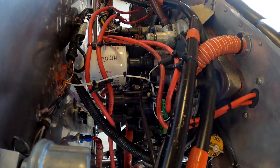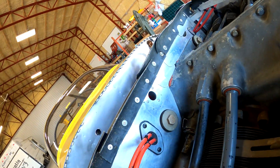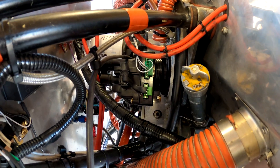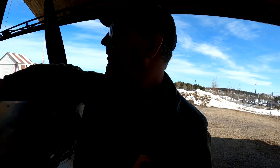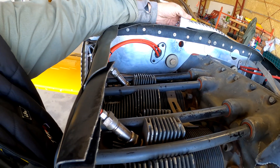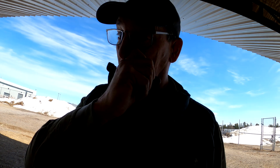Here it is — it's hard to see in there, but there it is, right there. There's my new e-mag. One addition I had to make was this little one-inch scat tube to get some fresh air from the top of the plenum and direct a little bit of that cooling air down to the fins on the mounting bracket for the e-mag. They suggested it might be a good idea to put a cooling tube on there, so I thought, what the heck? It took a little bit of work, but not a big deal. I've actually come up with this little idea for wintertime flying — if it's not needed, I can just block it off. So that's the little block-off for that.